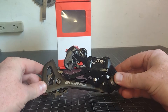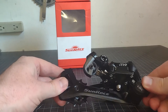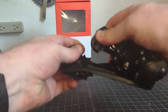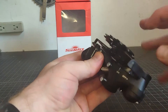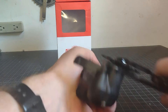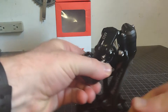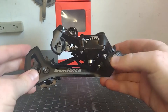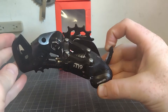But it does require a little work. This is the Sunrace RDM900, often shortened to the M9. It's a 9-speed rear derailleur compatible with Shimano. It can officially run up to a 50-tooth cog in the back, and we already know that Shimano 10-speed road levers work fine with any Shimano 9-speed rear derailleur. So this should work without any sort of tan pan or derailleur extender like a goat link, road link, or anything like that.